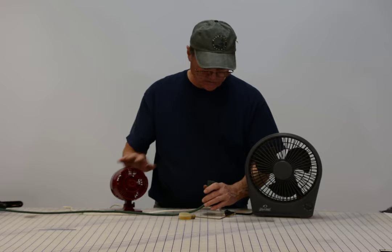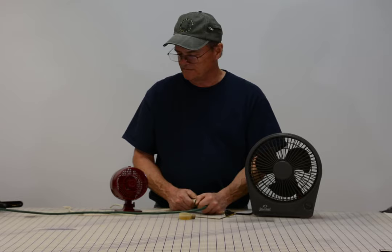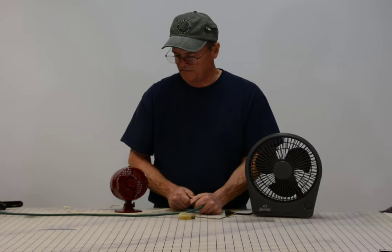And if you remember this one, it was making a lot of noise. When I plug it in now, it starts right off — and it's not making the noise we had before. Just two very small drops of oil. The blades kind of coast to a stop as well. You can tell when you put your hand in front of it — the fans are running a lot faster now than they did before.